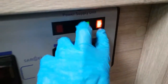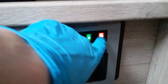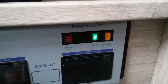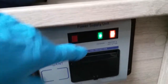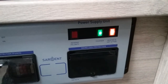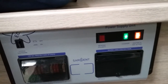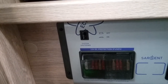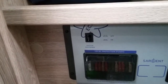Along the top we have two isolator switches for components that use main supply. The amber one is for the heating and hot water system — if you turn this off while running the Truma system on mains you will get a warning triangle and error code, so best leave it as is; it's more for maintenance. The green one is for the battery charger — turning that off means you cannot charge the batteries when hooked up to mains. This indicator here will illuminate if you have reverse polarity connected, which can sometimes be found on some continental sites. And lastly, full system shutdown — press this black button if you're not planning on using the motorhome for a longer period, and it will shut the back end down and kill any residual draw on the leisure battery.